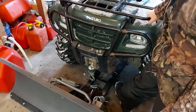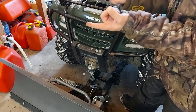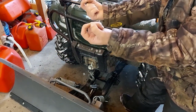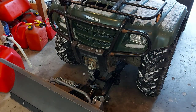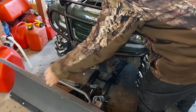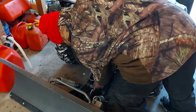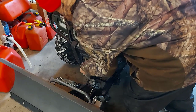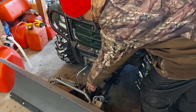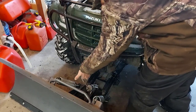Right here is a step pedal — you press on it and there are hooks underneath that open up. You put it up on the mount underneath your ATV, let go of the foot pedal, and the hooks come on and connect, and it doesn't come off. You also want to use your winch at the same time. So you have two hooks: one hook on your snow blade for mounting the snow blade to the ATV, and then there's a front hook for operating — lifting and lowering the snow blade during snow removal.